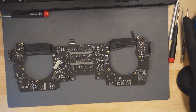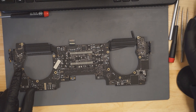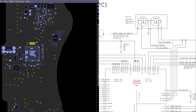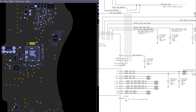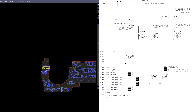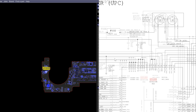We can open up a schematic for the 820-00239. As I said, we have chips called the CD3215s — there's one for each USB-C port, and this chip is going to speak with the charger. It allows the charging voltage to go through to the machine, and it also has bidirectional data lines with the charger, where it's going to tell the charger it wants 20 volts so it can turn on. This chip is powered by PP3V3_G3Hot.